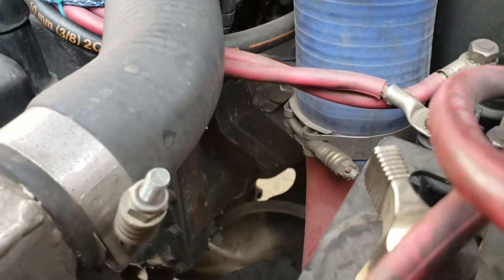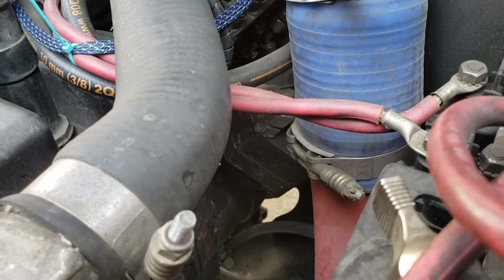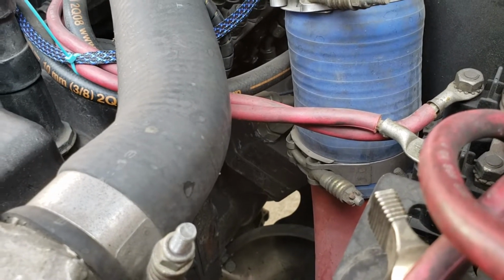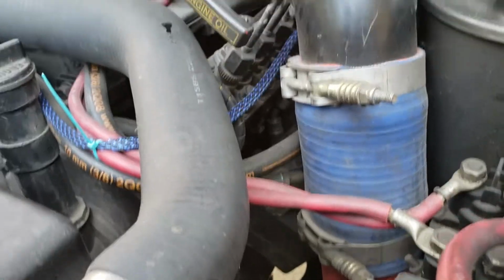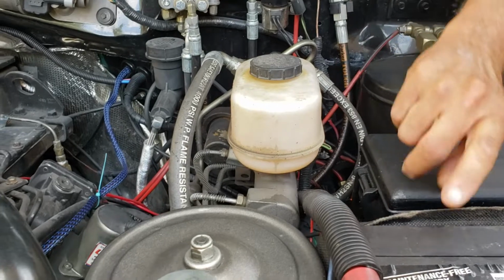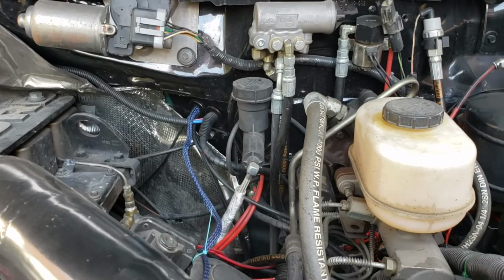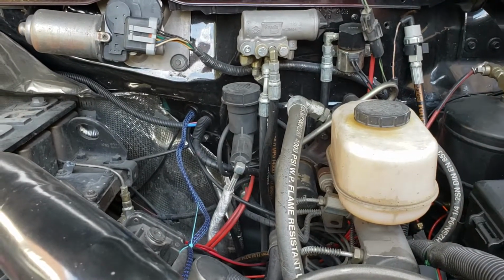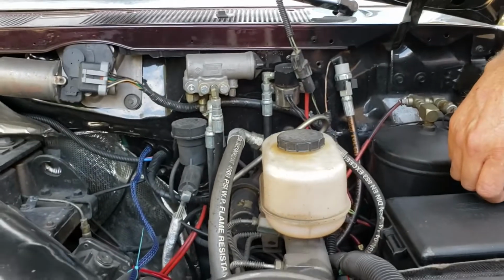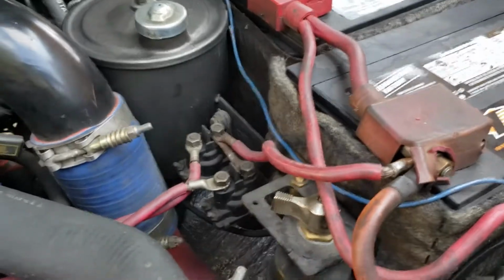That's going to be hard to see. Anyway, that's the head on it. Gear-driven air compressor, with a hydraulic pump bolted to the back of that. It's a 550 Super Duty brake system. 350s didn't come with anything but vacuum on the '95s. South Bend dual disc clutch. It's got a dual disc South Bend, with hydraulics designed by South Bend.